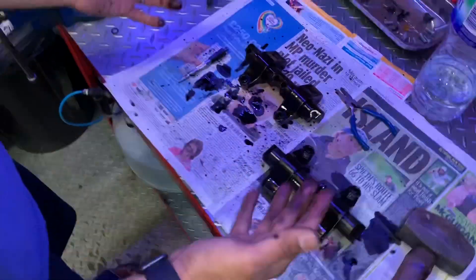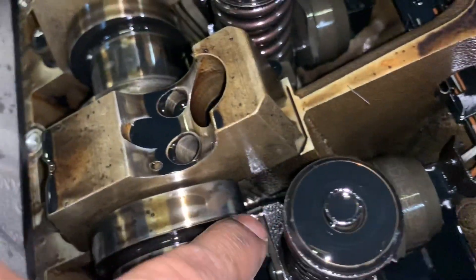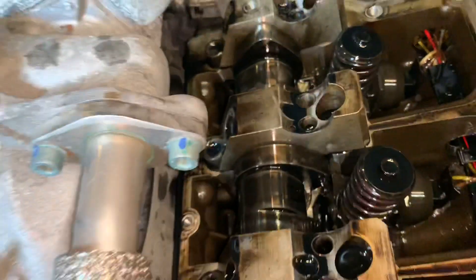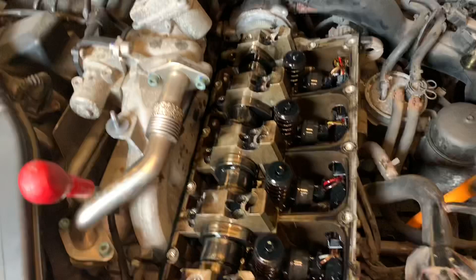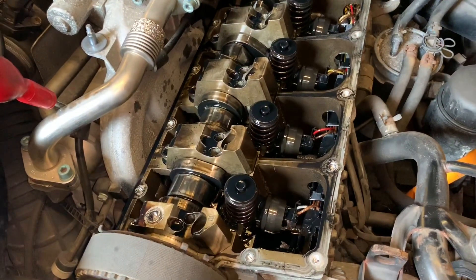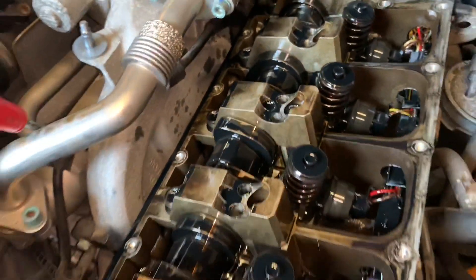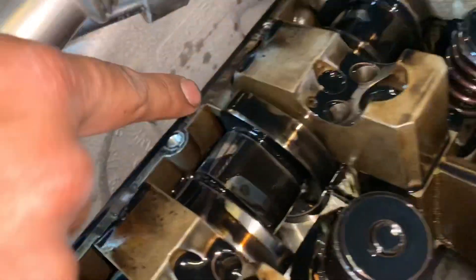Now you've got oil sprayed over the work counter - wipe that off. What we're doing now is inspecting the cam lobes for wear. You can't really see it very well in the video, but there should be a chamfer on all the lobes, especially on the genuine cams. That one's actually fine - you'll see a slight bit of wear there, but it's not bad. You've got to turn the engine over slightly and inspect the cams. I'll turn the engine while my colleague holds the camera. Don't start the engine - you'll have oil spraying everywhere. Just very slowly inspect all cams. Turn the engine over and inspect all your cam lobes. As long as you've got a chamfer, that means it's okay and it's not worn.